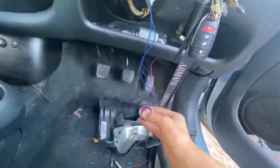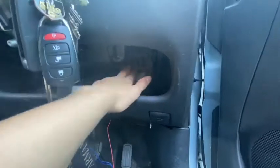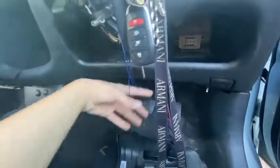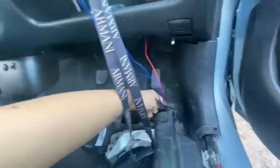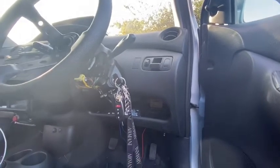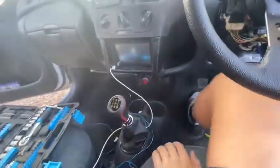I wired it to a fuse at the back — it still won't work until the ignition is on, then you press it and it starts. But I prefer the wiring point I used originally; it just feels easier and a bit safer than the fuse box one. I'm going to run the blue starter wires through here, tidy everything up a little bit, stow the relay box away, and then drill a hole in my dash for the start button — which is a little scary because I don't want to harm the dash.